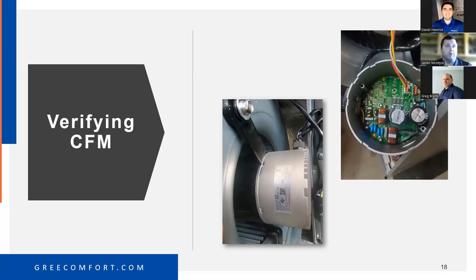There's an LED that will be flashing on the main board sending a signal back saying there's an error — specifically a shutdown error. So when you think about it: why is my motor over-amping? Why is my motor getting hot? If we're asking why the blower motor is shutting down, we need to look at why it's shutting down, not just the fact that it's shutting down.